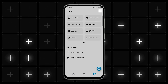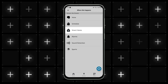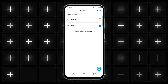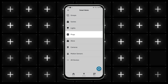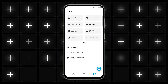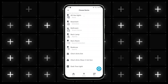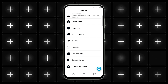Now back on the Alexa homepage, tap Routines and then tap on the plus icon at the top. Under When, tap Add an Event and then Smart Home to find the Philips Hue sensor. Now choose When Motion is Detected and then Next. Tap Add an Action under Alexa Will, then Smart Home, then Plugs, then choose On. Tap Next and then Save. Like the Google Home example, you'll need to instruct the Smart Plug to switch off when no motion is detected. Tap the plus icon, then tap Add an Event under When, then Smart Home to find the sensor. The option is already set to not detected. Set the time you want the routine to switch off the light when the sensor doesn't detect any motion. Next, tap Add an Action under Alexa Will, choose Smart Home, then choose Wyze Plug, then Off.